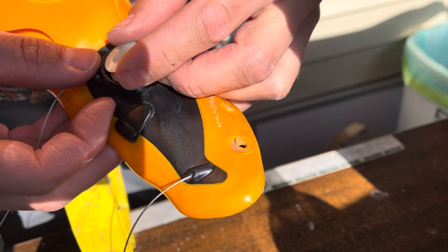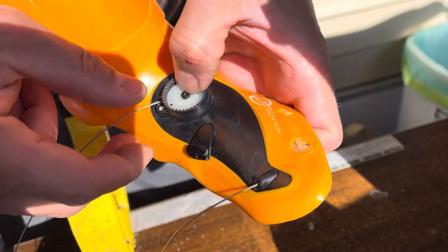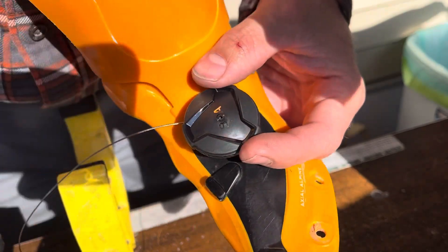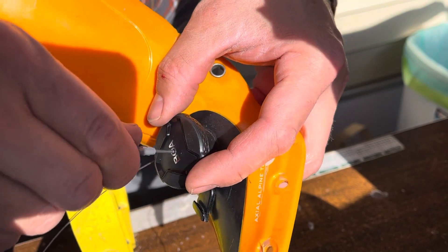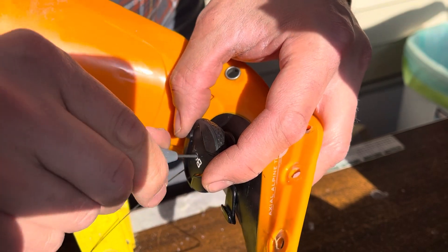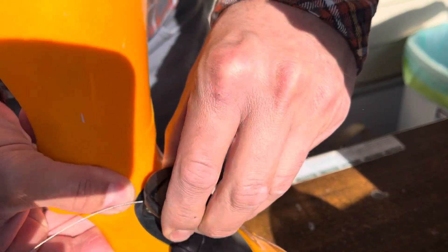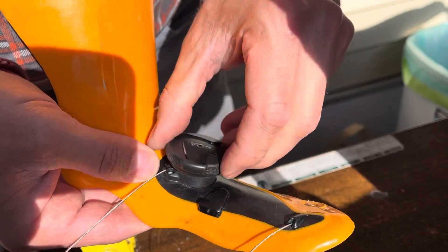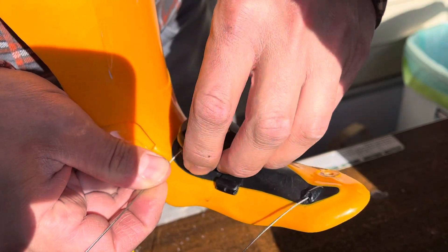Anchoring it back into place, make sure it's proper side up — you want those top splines facing up. Now it's time to replace the knob; they send a new knob so use that. Screw everything into place, push it down and test it to make sure it's pulling the cable the way it's supposed to, and pops up to release. It does that just fine — it's great to have this working again so quickly and at home.